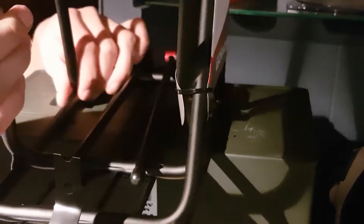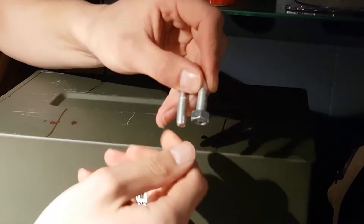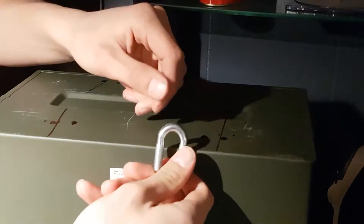To mount the box to the top of the rack, I needed to mark holes for U-bolts. The great thing about using U-bolts is there is no mounting hardware exposed to the outside of the box. In other words, nobody can come along with a socket wrench and remove the box from the rack unless they have access to the inside of the box.